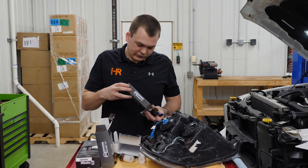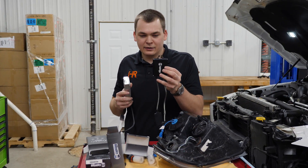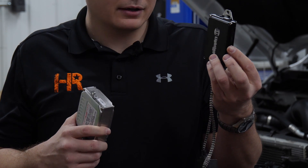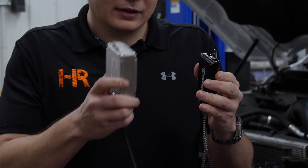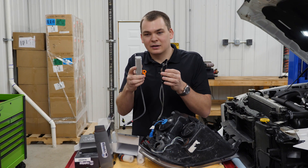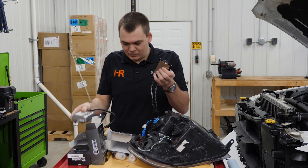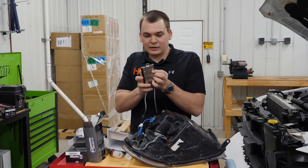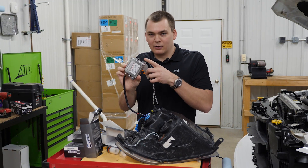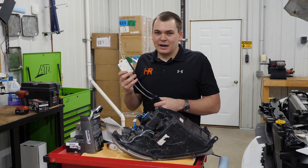I wanted to show you what we used to sell for this truck versus what we've got today. This is a smart PWM ballast from GTR Lighting — it's about as thick as a playing card deck, a little thicker than your cell phone. This was the only ballast that used to work on these Rams, and sometimes you'd need an additional harness. Look at the difference in size. Not only that, but these new ballasts come with a double-sided tape mounting solution so you can just stick this thing anywhere, which on these Rams is helpful since it's pretty tight back there. The new fifth generation ballast saves a lot of effort and is a lot quicker to install.